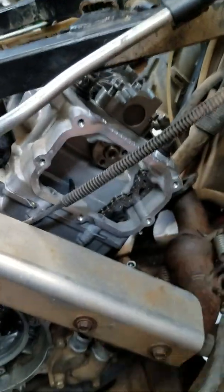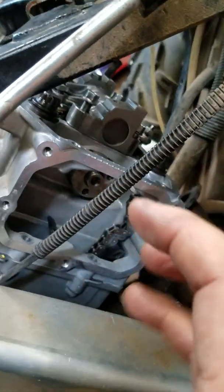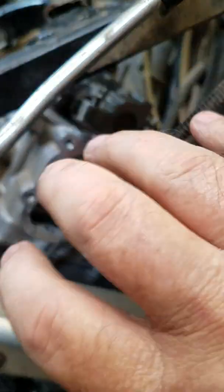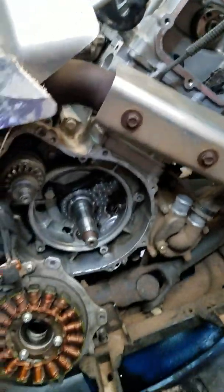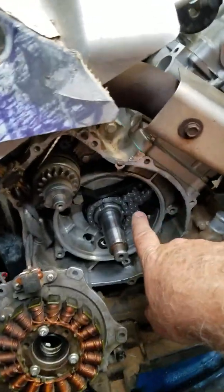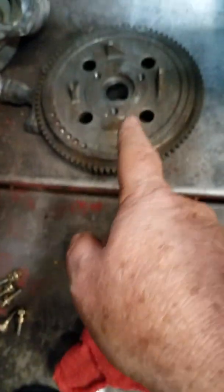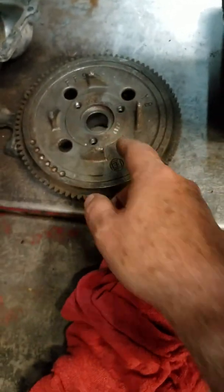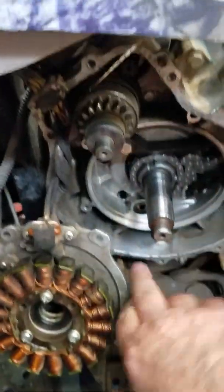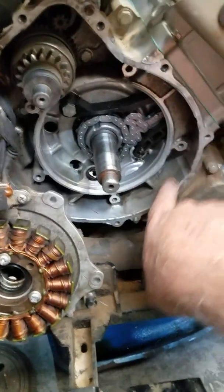If you don't think so, back it up on the chain. You just got to lift the chain up off the sprocket, turn the sprocket before you put it on the cam to change the sprocket in relation to the chain and the crankshaft. Just work at it. I've got this open because I put a new cam chain in it — a stator, five bolts, flywheel, a nut, and then an old school Chevy 350 puller. Pull it off, then this recoil cover. This in here holds oil; the stator behind it holds oil. Here's your seal. This out here is dry — it does not hold oil.